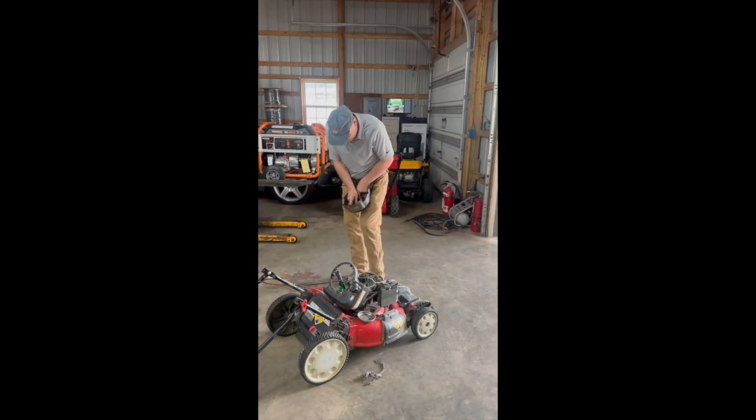Continue to wind this up, and you'll get a feel. You'll feel it where it can't go too much more, but you don't want to break the spring going forward. So that's getting tension on it there. And again, we're going to line it up to this opening over here. Go back a quarter turn here. That's probably good right there. Again, I'm going to put the pick in here, or it could be anything, a screwdriver or anything.